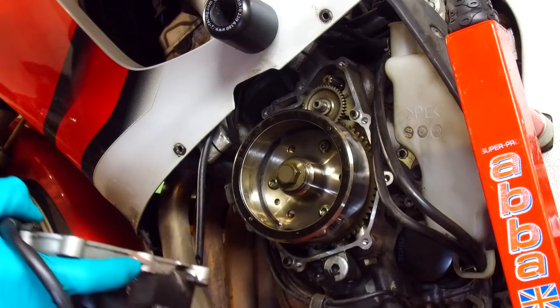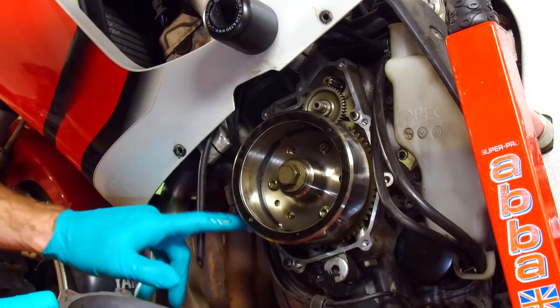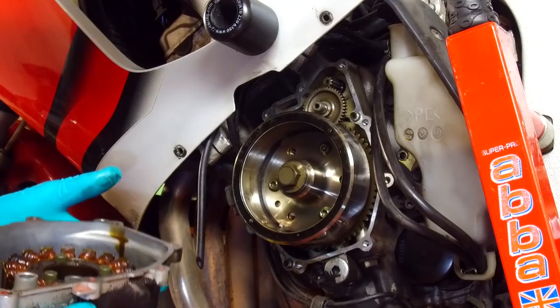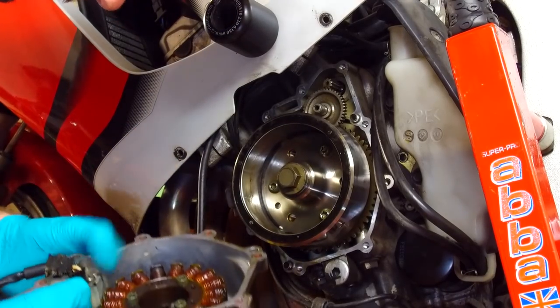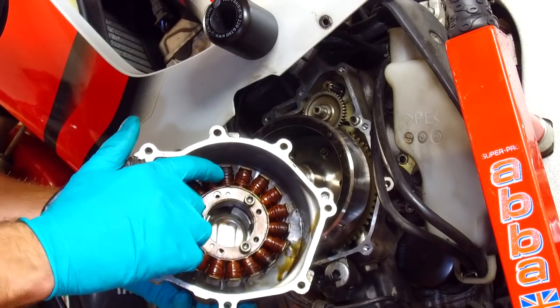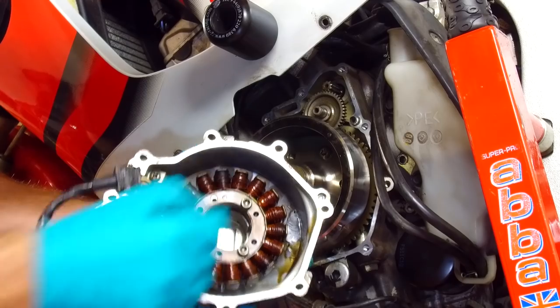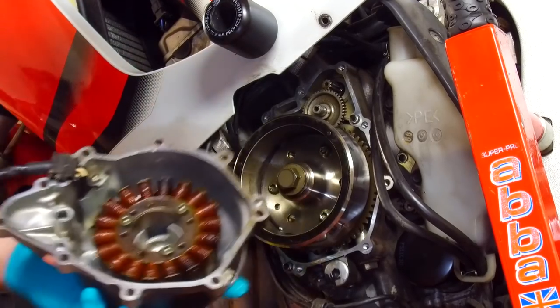Okay, a little bit of oil. Ooh, no gasket. Somebody's been in here before. Well, we know that because they welded this cover up. Okay, I don't know whether you can see on camera, but burnt, crusty windings on this one, and on this one, and this one. I'll get you a better shot of this now on the bench. Have a quick look at it.